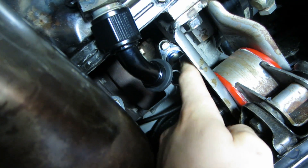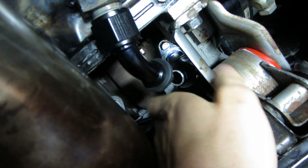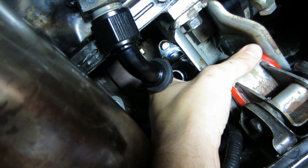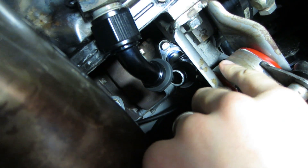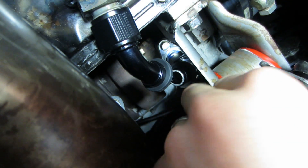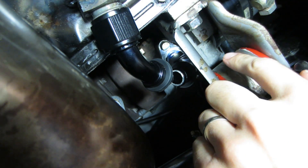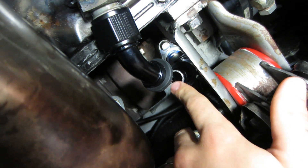We can adjust the bottom one, but make sure there's enough clearance between the motor mount and where your hose is going to be. If you have to angle it a little further out, do so now. We're going to make a mark of where this piece is facing off of the silver flange. This piece of the fitting rotates, and the blue piece that goes into the silver flange will also be tightened. We need to mark which side of the flange faces toward the cabin — I've marked that with whiteout. As you can see, these fit very nicely: I used a 45 off the CHRA and a 60 off the oil pan.